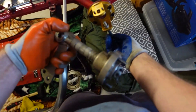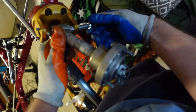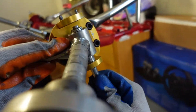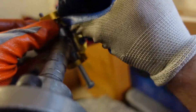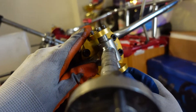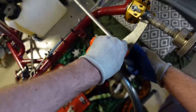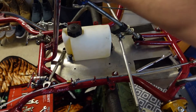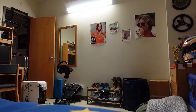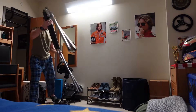I got new kingpins for the front. The last ones were from 1880. These are the spacers — I couldn't visualize how it all comes together until I did it. I take the spindle, put the spacers so it sits nicely in the housing, and put the kingpin through. You can start to see how it actually works on the track — at the very end where those bolts are, you can see how when you're turning the steering wheel it all works, and the tire would bolt onto those bolts on the wheel hub.